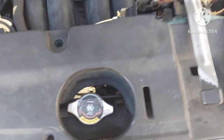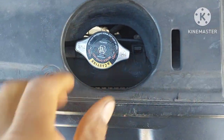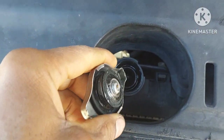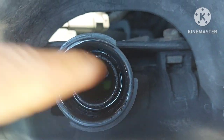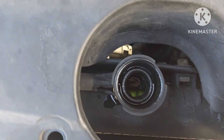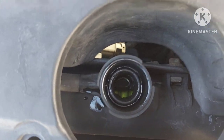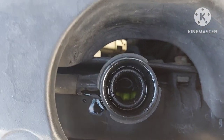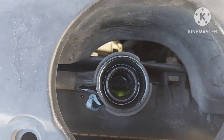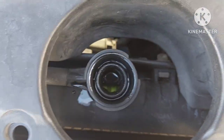My radiator should be thirsty for antifreeze. The CRV has been sitting for about an hour to cool down. I did add a load of water earlier — that's when I found out it was leaking. I can see a little antifreeze in there with my finger, still some room. The product says to shake it really good. I want to see if it has any grit in it — if it does, there's a strong chance it'll clog your thermostat as it tries to pass through and builds up around it.